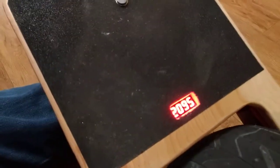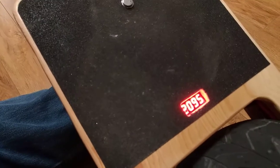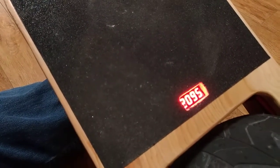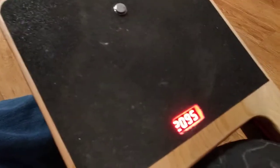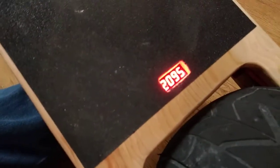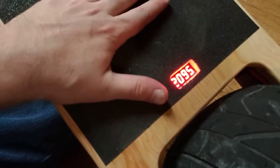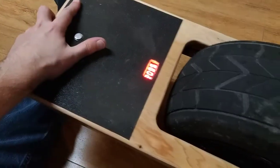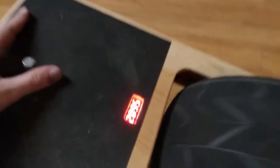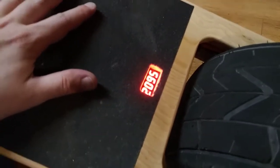The second setting is your max power setting. I set mine at 95 simply because the VESC has a max duty cycle of 95 — not sure why, but it's in there. Once you've set the max limit, this tells the board to start kicking. A kick is a preset value: once you've hit the max value, the board is going to kick up on you — hard accelerate — which forces the board up and forces you to brake. It does that continuously, basically telling you that if you don't slow down, you're going to get hurt.